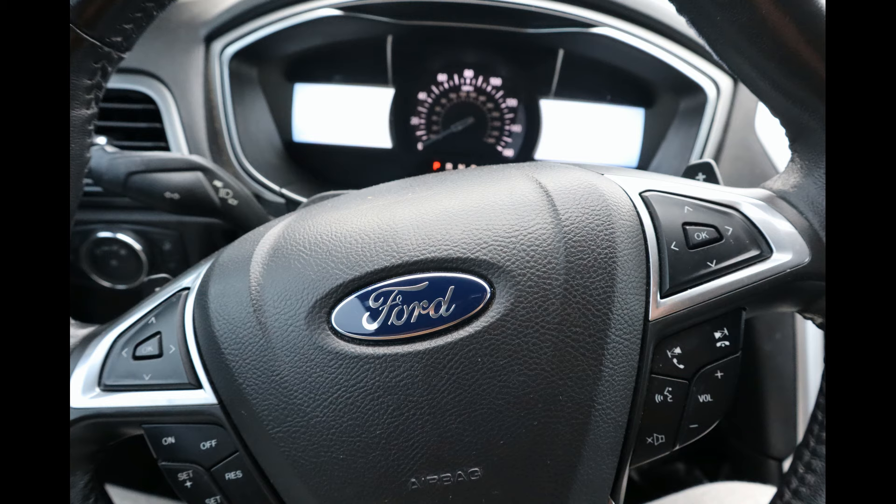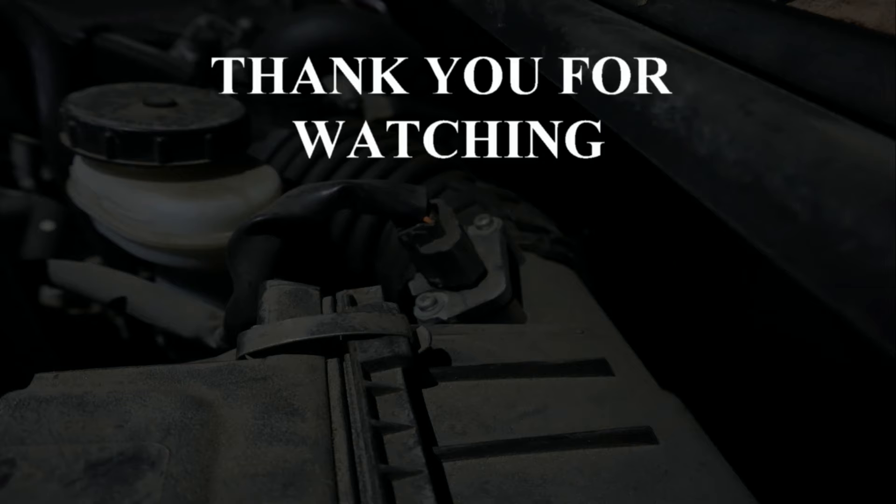But in reality there's more air and less fuel, creating that improper air-to-fuel ratio which results in a misfire — and this misfire is what causes the vehicle to have a rough idle. Thank you guys so much for watching, I appreciate all of you, I hope you have a fantastic day.